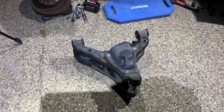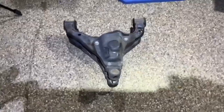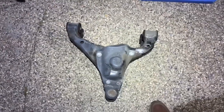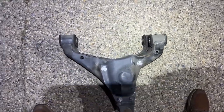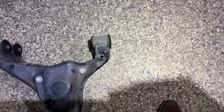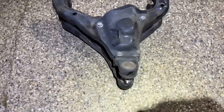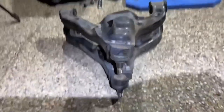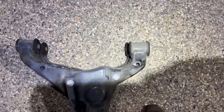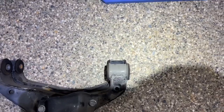Here, the two control arms. The other one that I picked up was also from 2019, and I think it had like 4,000 miles on it, but here's what we got. Now I was trying to see how I can tell if they're bent, and I'll do some more measurements in a little bit, but the best way from this angle, I decided to go ahead and put them one on top of another one. So we got this one pretty straight, and then this one pretty straight, maybe a tiny bit off, but I might not be lined up perfectly either, or maybe I am, I don't know, but from this angle it all looks pretty good. So that lines up, that lines up. So yeah, it does look like it's a tiny bit off on the right mount here. Okay, so we got that.